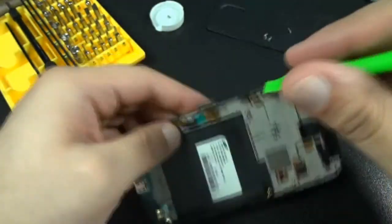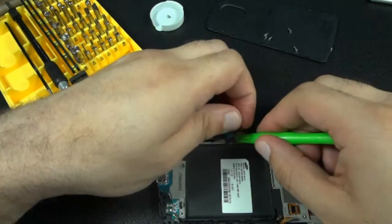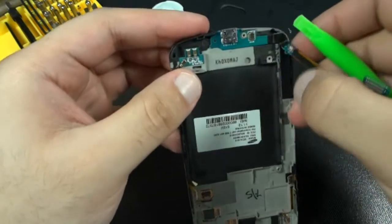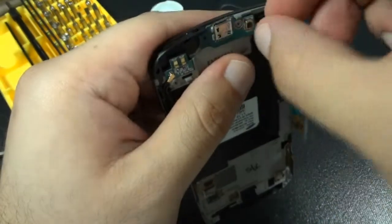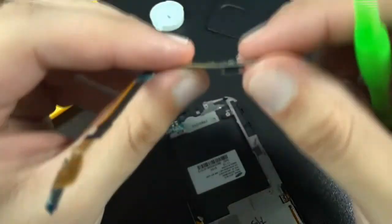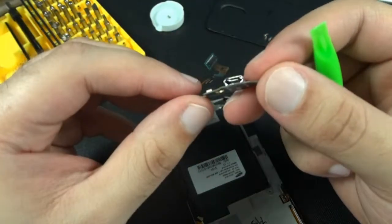This is all your USB. It's held in by a little adhesive, so don't pull it too much. Down here be really careful — you don't want to pull too hard. Bend this a little bit, it's alright, it's meant to be flexible. So if you have a bad USB port, this would be the time you would put in your nice new one. This one's good.